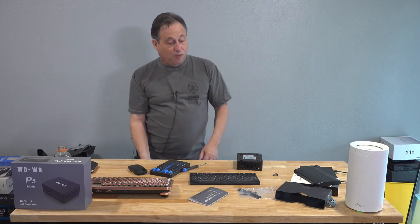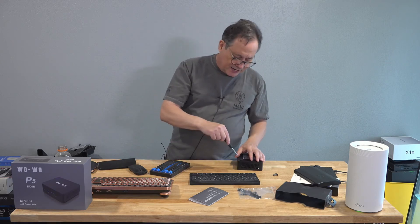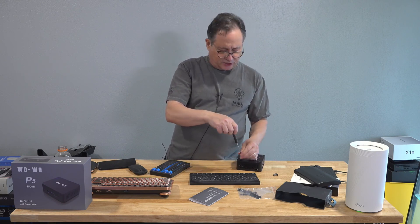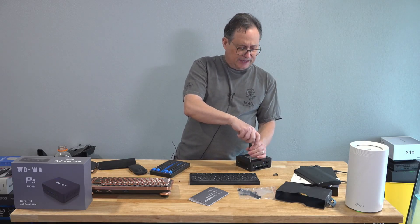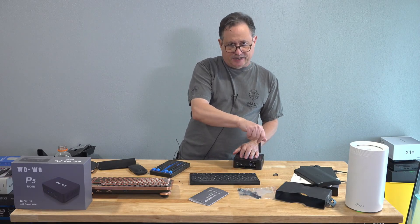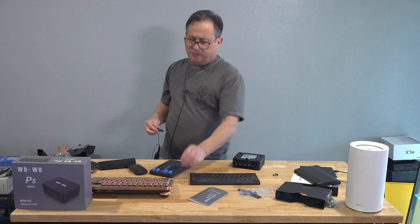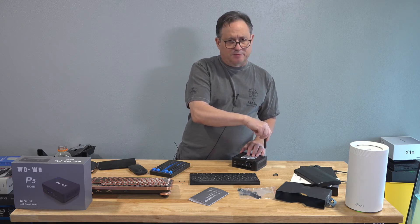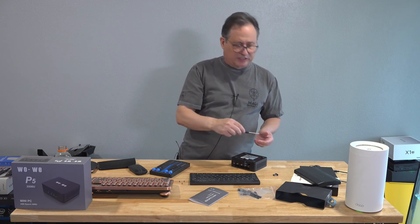This should just take minutes to demonstrate — it's that easy. This machine isn't really designed to be upgradable. The processor is soldered to the motherboard, as all portable chips are — you cannot change that chip, and it will always be your bottleneck. You can throw all the RAM and storage you want at it and it's not going to go much faster. If you really need that much power you probably shouldn't be buying this level of computer. Upgrading it will cost you more than if you'd just bought it with what you wanted from the start.